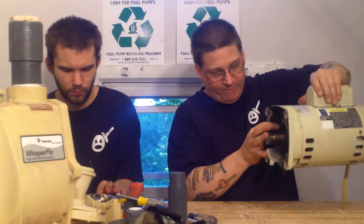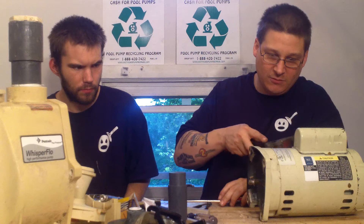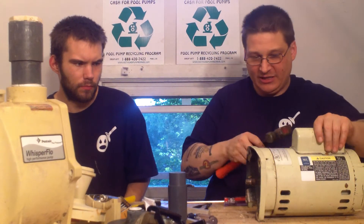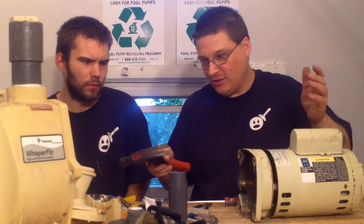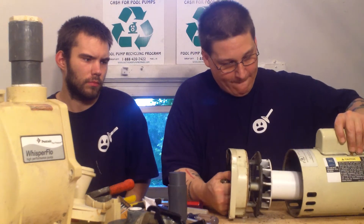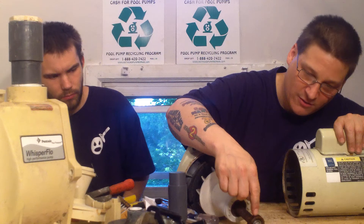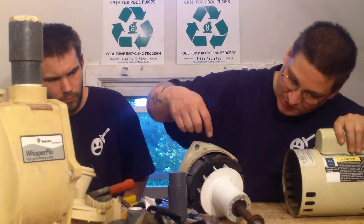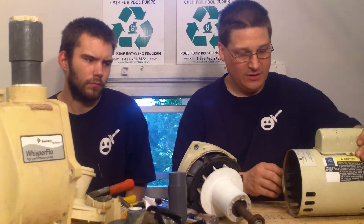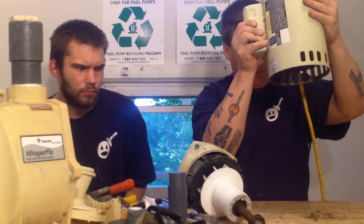Once you remove the four through bolts, get the plug out of the way. Take your hammer and just tap the motor casing a little. As I tap the motor casing, you will see that the motor starts to separate. And voila — there's the number one bearing in the back and there's another bearing in the front. I'm going to show you in the next video how to access this front bearing. There's a little bit of dirt in it — we'll pour it out.